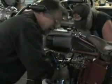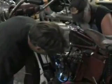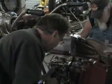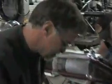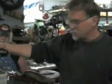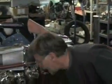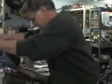What we're going to do is go through the standard starting procedure, which is to turn the gas on, hold the little carburetor tickler down, which is right here, and I'm looking right into the float bowl of the carburetor, and the tickler is working. The float's full. We'll put that back on. We've already adjusted the carburetor. I was going to have Matt come out here and start the bike. Don't know where he's at, so I'm going to give it a shot. By the way, the Indian motorcycle throttle is on the left, unlike a normal motorcycle of today. So I've got the timing set halfway on the mag, carb's ready to go. Indian also kicks on the left. Here we go.